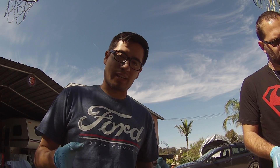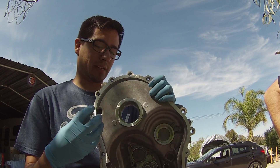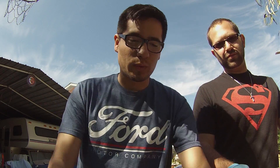On that last one, something you guys didn't see is that we had to remove the race for the new bearing of the LSD, so we went ahead and did that. This is the second one — we've done that off camera — and just to show you, it's completely bare, so we're going to have to put in the new race and then the seal on the other one. Don't forget to do that, otherwise you're probably going to have to break a seal. Luckily because there's a thickness difference, we were able to get a screwdriver in there and pop it out without any issue.